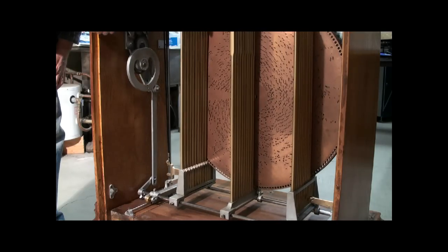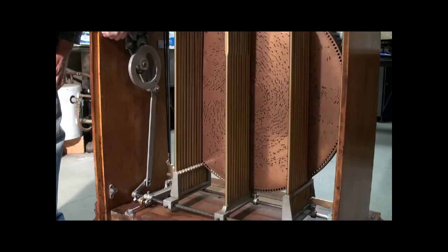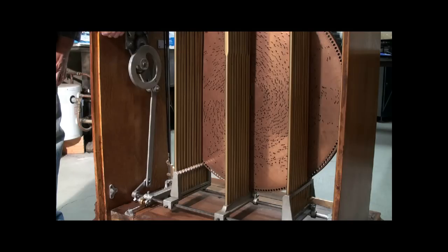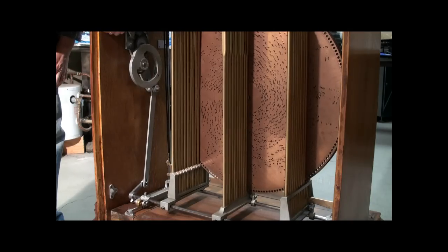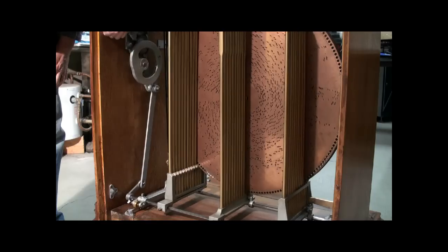We get one full increment each time the next disc is played, like that, and then it plays the disc, ends back up in this condition at rest, goes to the next disc on the next play, and then when we get to the very tip of the heart-shaped cam, that will again reverse the linear motion of the carriage. Last disc, and then back in.